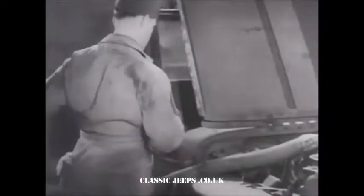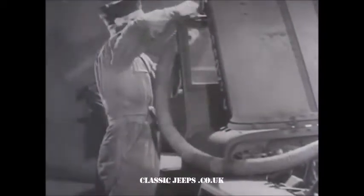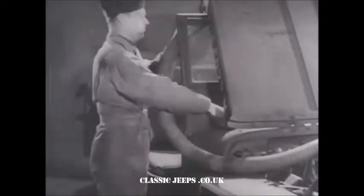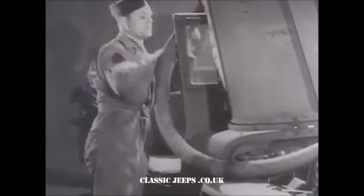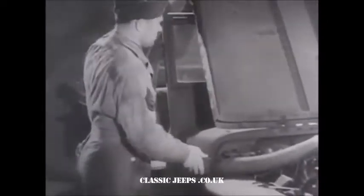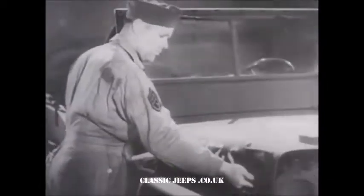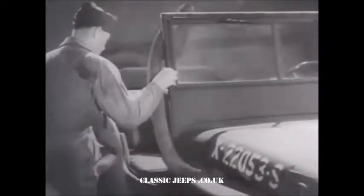The free end of the flexible tubing is brought out under the rear lower part of the hood, up along the windshield, and finally fastened with wire to the small loop on the top of the windshield frame. Care must be taken when closing the hood to prevent pinching down upon the flexible tubing. And stage 2 is completed.